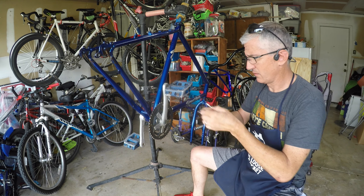I put the front derailleur back on. The important thing when mounting a front derailleur is to make sure that as the arm swings out when engaged, it doesn't hit the crank, but it's also not set too high — if it's too far up it won't derail the chain correctly. There's a sweet spot between being too close and too far, and you need to make sure the front derailleur is set correctly.